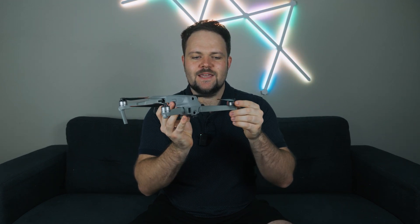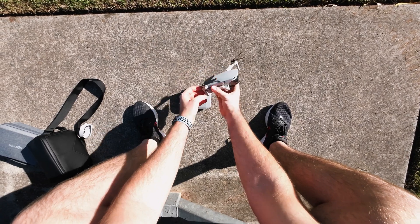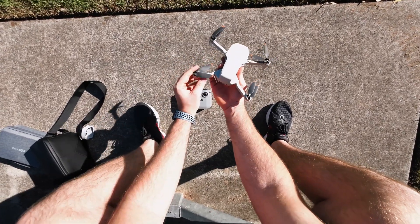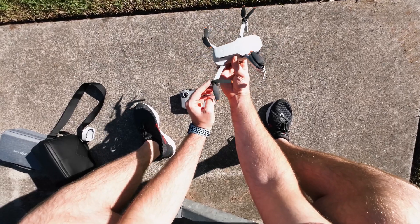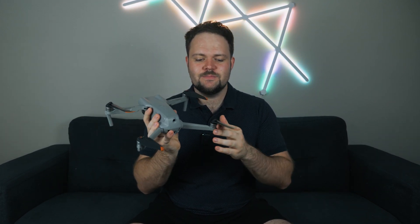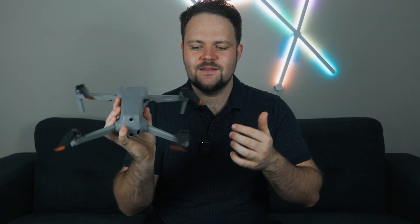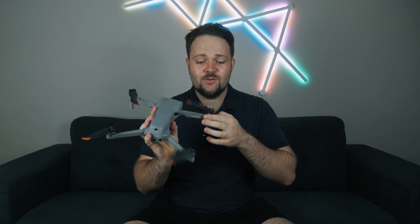The first thing you want to do is as you unfold the drone, depending on which drone you have, you'll see that you've got these little motors here. They're normally going to be metal like this, but if you've got one of the mini drones it's got more of a plasticky feel. All the drones you're going to be using, if they are a DJI drone or a relatively high-end drone, they're going to be using brushless motors — which this Air 2S is using. As you spin the actual motor itself you'll see there's no resistance, you won't hear any grinding, it's just so smooth because it's brushless — there's no contact at all. That's how the motor needs to feel.